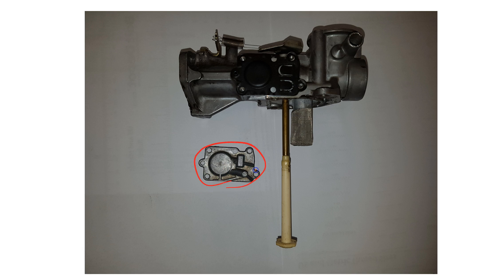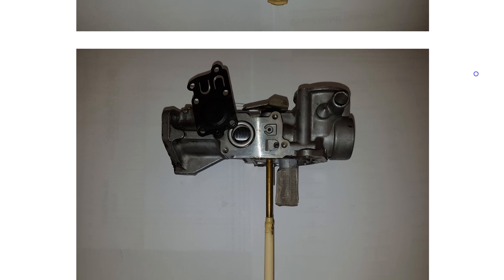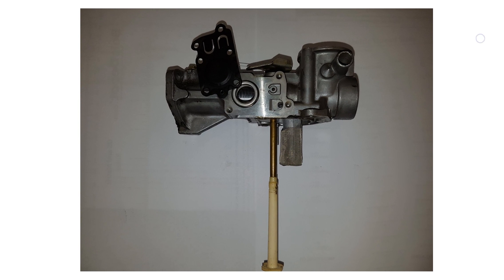We've taken the pump cover off, and once we've done that we see the pump diaphragm — the diaphragm is this little circle. That little circle fits right in this area in the fuel pump cover pocket. Then we have a little valve, a little flapper one-way valve, and another one right there. Once we pull the diaphragm off and look underneath, we see this little ring right here, and underneath it you can just barely see a spring that pushes out against the diaphragm. You'll also see a couple holes — this is where one valve was and this is where the other valve was.